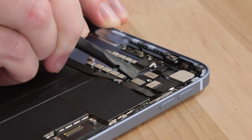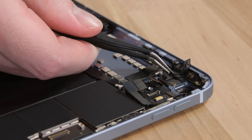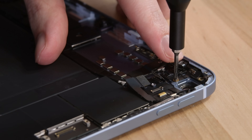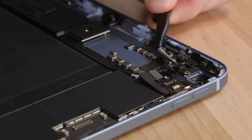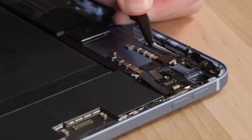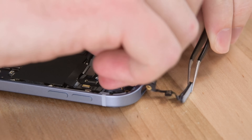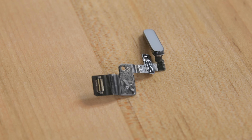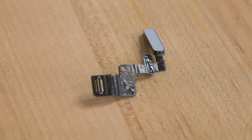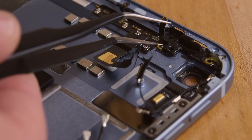Since a lot of this is looking familiar, let's head right to the interesting stuff — the Touch ID corner. First, we get the 12-megapixel rear camera sensor out of the way, then it's a whirlwind of screws to remove and cables to disconnect. After some generous heat, the fingerprint sensor cable comes up, and more heat allows us to move the button's bracket and push the button out through the top of the iPad. Apple's VP of Marketing mentioned in a podcast that this button was an incredible feat of engineering. It was apparently tricky to ensure the antennas in the cellular model and this button didn't interfere with each other — this whole corner of the iPad Air is jam-packed with hardware, so that we believe.